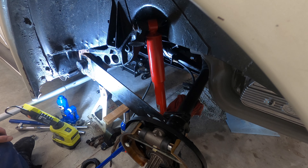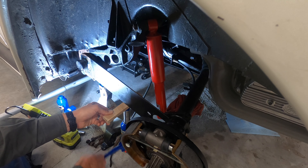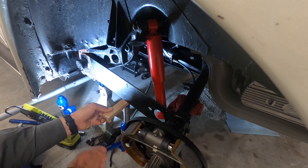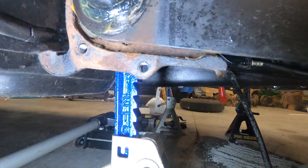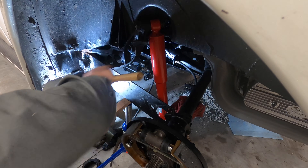Something else to note when taking it off: make sure the torsion bar isn't coming out of the spline — it should stay in the center. If it does come out, you're going to negate the whole point of marking where it's currently at. You want to raise it up past that stop so you can put the cover back on.